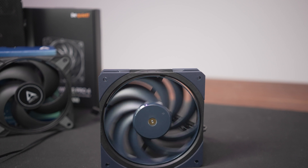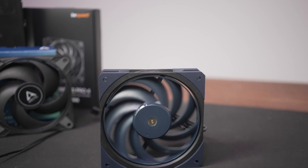Normally running your 120mm fan past 2000 RPM is going to result in a lot of noise and only marginally more performance, so usually I don't recommend running fans in this range. If you can, it's always better to get more fans and run them at a moderate RPM — such as getting a bigger radiator if you have the space — but there are times when you are limited to the space you have and you do need that RPM range for those special moments. One of the reasons to invest in a higher-speed fan is to actually take advantage of those higher speeds, so let's take a quick look at a use case for that.